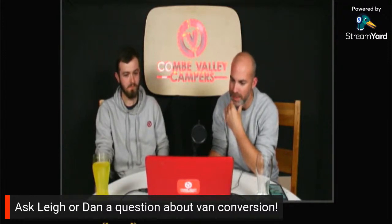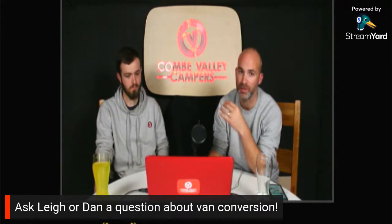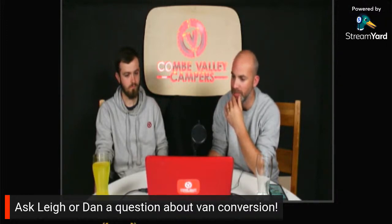Colin Vanful is telling us how he removed the torque bolts, or the shear bolts, from his steering column. He says, I used a Dremel and cut a slot in them, damn column bolts, and then hit them with an impact punch with a flat bit in it. Yeah, another option. Good shout.